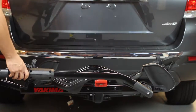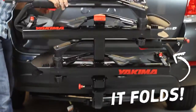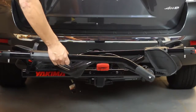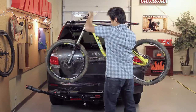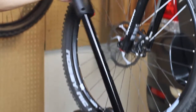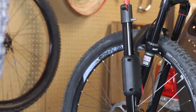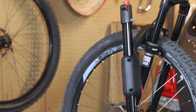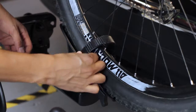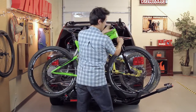When not in use, always fold the HoldUp in the upright position — fold the wheel trays inboard and rotate the pivot arms down as shown. When you're ready to load bikes, simply pull the spring pin and fold it down until it snaps into place. To load your bikes, get the heaviest bike on first, putting the front wheel on the pivot arm side. Rotate the pivot arm up until the hook rests on the bike tire one inch or less from the fork. Secure the hook by pressing down firmly, then secure the rear wheel with the wheel strap, threading the strap through the spokes and ratcheting it down through the buckle. Load the second bike the same as the first, but in the opposite direction.